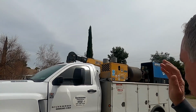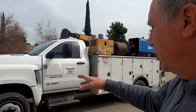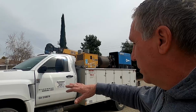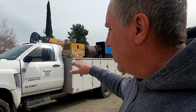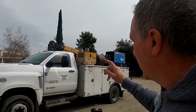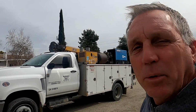I recommend this truck. It's a great truck, but you will have to do some spring work to it. If you get a four-wheel drive, spend the $6,000 per axle to buy the kit from Kelderman for the air springs, or take it to a good spring shop, explain what you need on it, and if you do what I did, it's going to run really good. I'm really happy with the truck though, especially now that it rides good. I'm super happy with it.